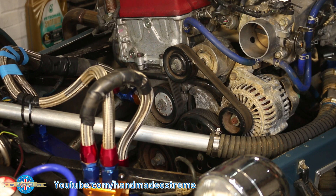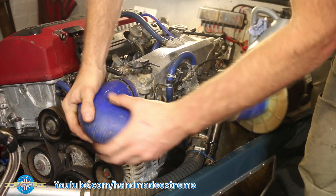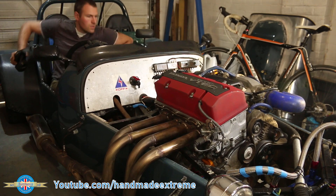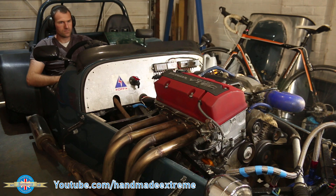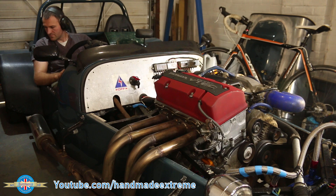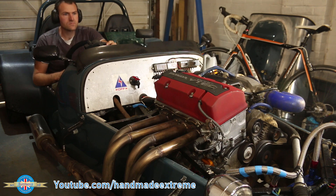Before restarting the engine I took the spark plugs out and cranked the engine over a few times to just circulate the oil around the system. I also did a compression test which all came back fine. I'd better just put the air filter back on as well — this thing's like fighting with an elephant's trunk. Here we go — the moment of truth, fingers crossed. Oh yeah, she's loud! All good so far. Once the weather gets a little bit better I'll take her out for a test drive and check that the overheating problem's been fixed. Unfortunately there's not going to be a video next week, but I should be back the week after with the chemical blacking video that some of you have requested — thanks for watching and I'll see you then.